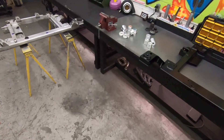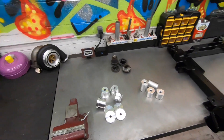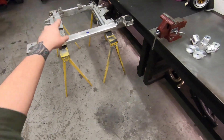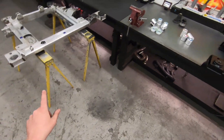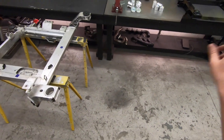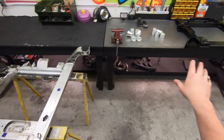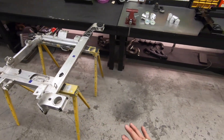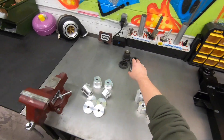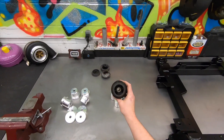Brandon Furches, LS4 King. Today we are talking about subframe bushings. Here we have two examples: an LS4 subframe and a 3800 V6 subframe. They're both aluminum construction, both for W-bodies, they're interchangeable, and the bushing design is the same between both platforms. What we're going to discuss today is the shortcomings of the OEM rubber bushings and how we can improve on this design.